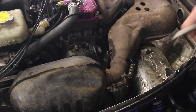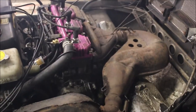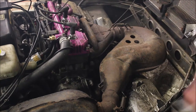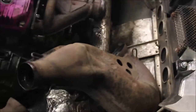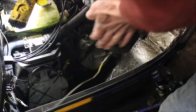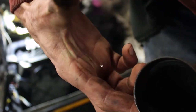I'm going to finish taking this apart and take all the springs off all points of the exhaust, including up here. You've got three springs here, a couple springs there, a couple holding down. I'll pull that out and take the exhaust off to access the water pump. Don't forget to unplug your wires for your muffler. With this part off, turns out I think I am leaking a little coolant. I've got a little bit of kind of milky, oily residue — that's telling me coolant's getting in the exhaust. Good thing I caught it when I did.